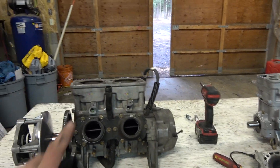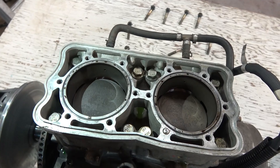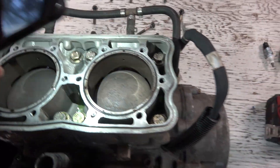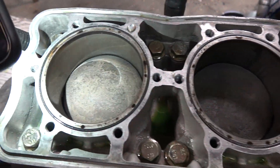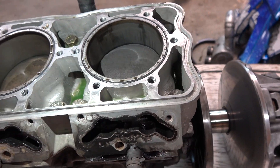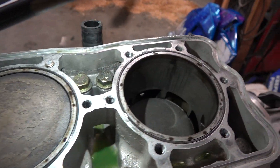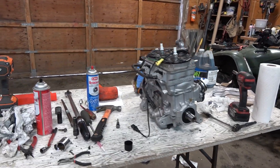We've got both motors on the bench now — the old motor and the new motor. This is the side that had low compression, and this one had better compression. You can definitely see some wear and tear here. On the other side, you can still see all the crosshatch marks and everything — it's looking pretty good. But the low-compression side is definitely more worn looking than the other side. Good thing we're doing this.